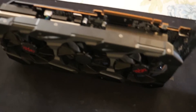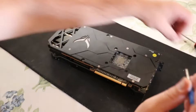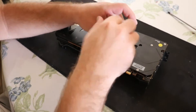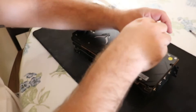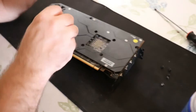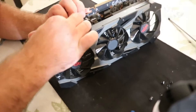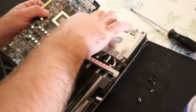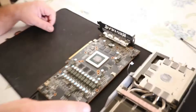You need to unscrew all of the screws on the back plate. Start with the screws around the actual chip — there are four around the chip — and do them in a diagonal pattern, which is preferable. You're going to do the same thing when you put it back. Gently pry it apart, and as you do, you're going to have to unplug the fan. On this graphics card there's also another set of wires that need to be unplugged as well.